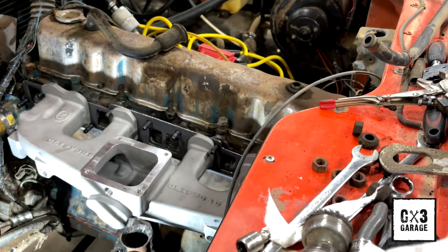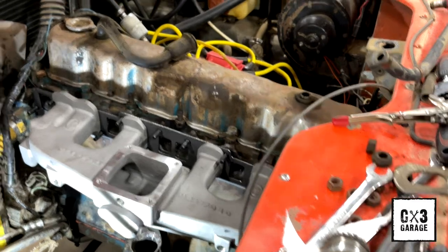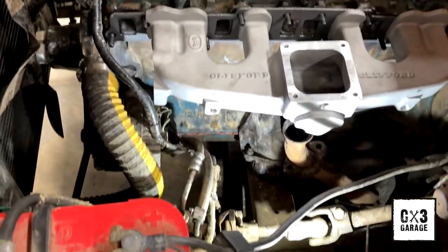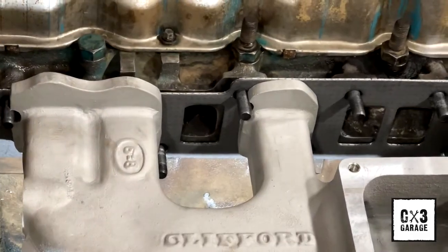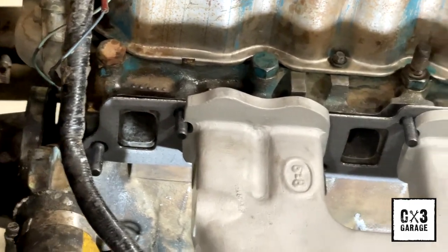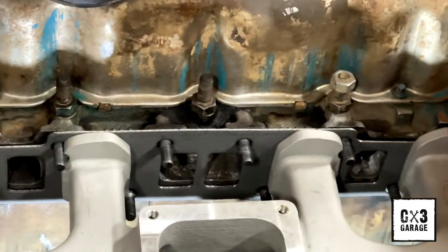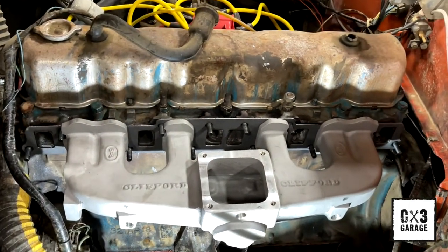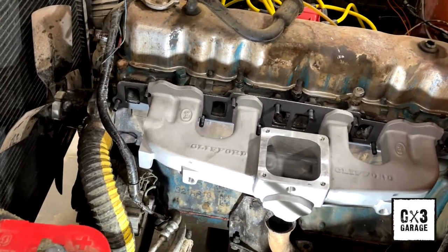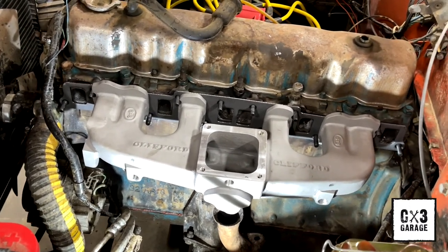They share each other here. They share studs, obviously. So they've got little grooves, and I'll bring you right there and show you. They got little grooves that those studs just go around. And that's kind of what holds them in until you get that flange washer or that big heavy washer and that flange locking nut. Get that on there, and what you do, as per the instructions, you actually bend that washer over onto the intake and the header just for added grip, or I don't know what you want to call it, added clamping force.